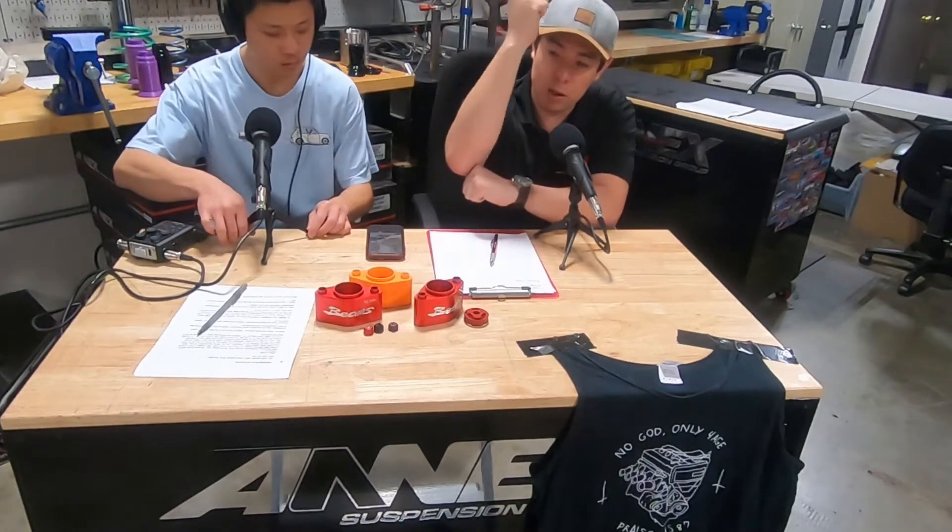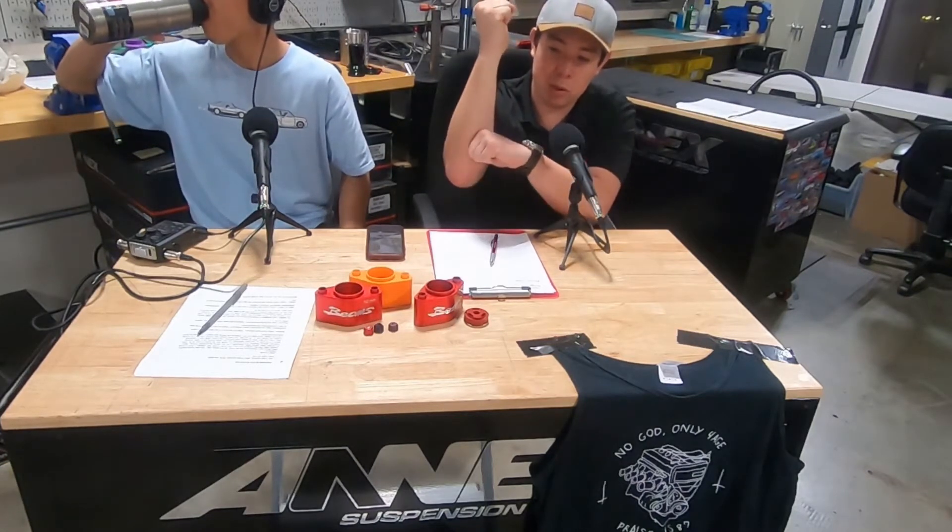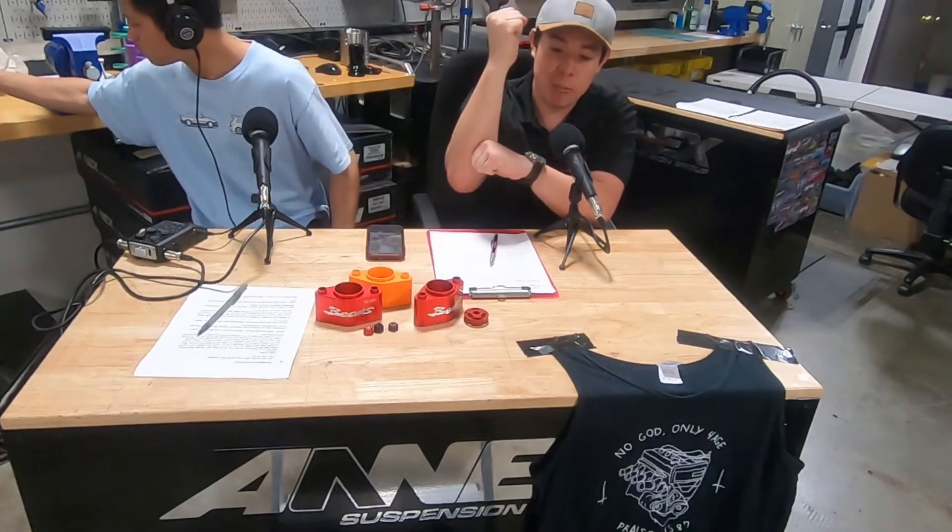This causes a variety of bad effects such as bump steer. But most importantly, the roll center starts to go really low. What that means is if you have the center of gravity here — where my fist is — and the roll center is down here, you've got a leverage force. So you're getting more roll with the car with the same spring rate than you would if the roll center was higher, because there's less leverage up there.